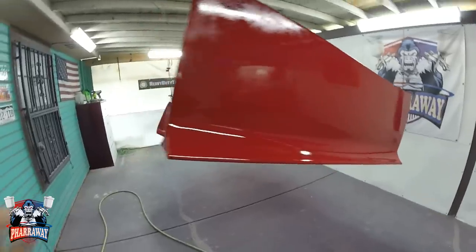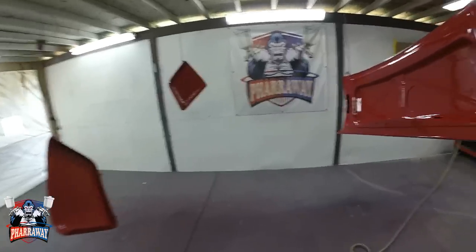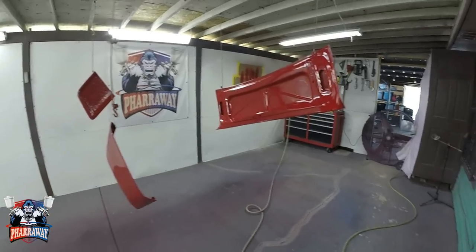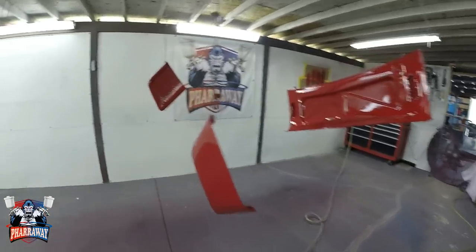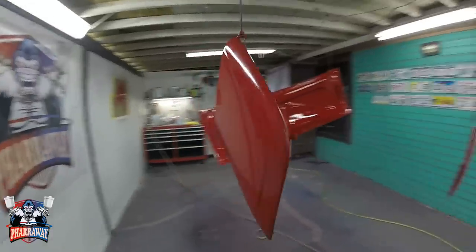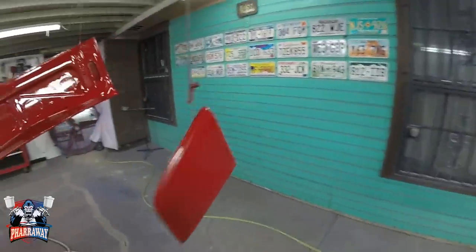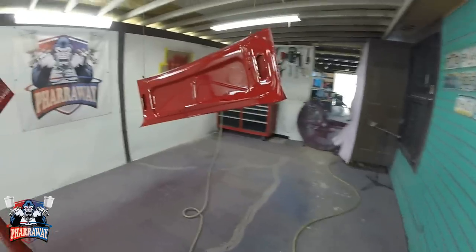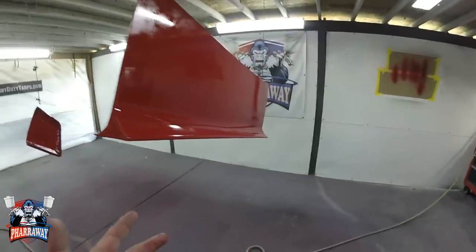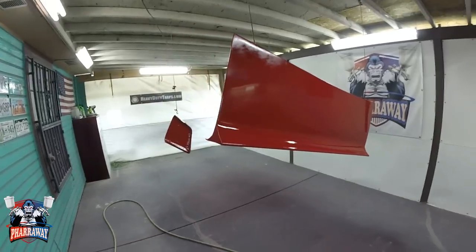All right, the first coat of clear is applied. Now this is called a tack coat. Reason being is that this is gonna get the other two or three coats that are coming up to stick to, okay? So you don't apply it super wet because it's gonna run. You're gonna create a run. So you just mist it on and just wait. I'm gonna wait 15 minutes and the other two or three coats that I'm gonna apply are gonna be a lot heavier. You'll see the way I'm doing it.